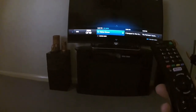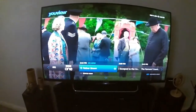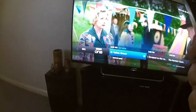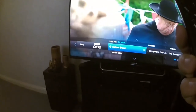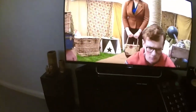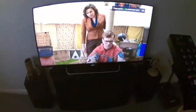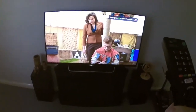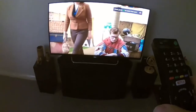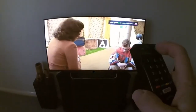Yep, all okay — fully working. So this is a Sony TV RMT-TX100D remote control. Cleaned up with soap and water on the circuit board where the contacts are, cleaned the rubber membrane up with soap and water, let it all dry, put it back together, and it works fine. There we go — another thing fixed.